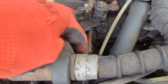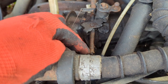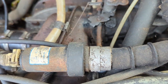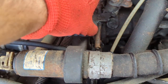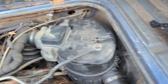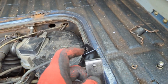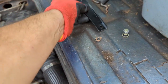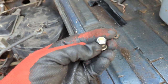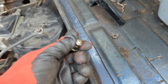So I would recommend that if you're an automatic Vanagon owner, have a spare one of these clips in the glove box. It's so tiny you need to have it in its own little separate bag, clearly marked what it is. You also want to make sure that this lever — this pivot point at the top — is lubricated. I usually use some white lithium grease.